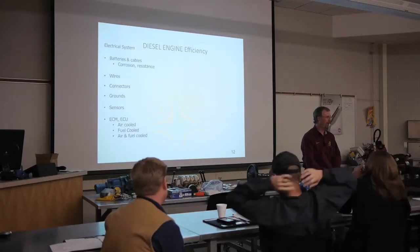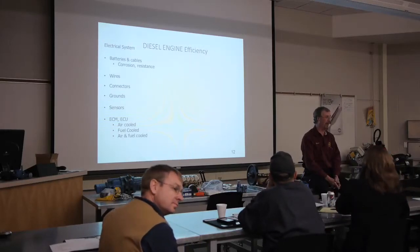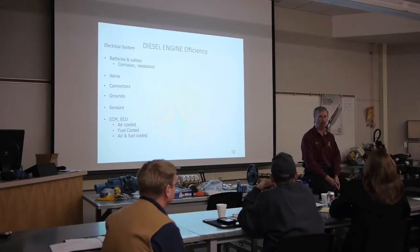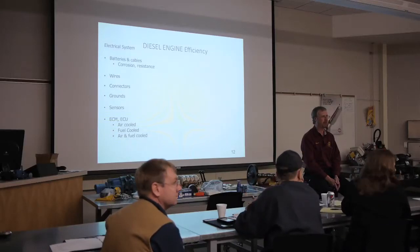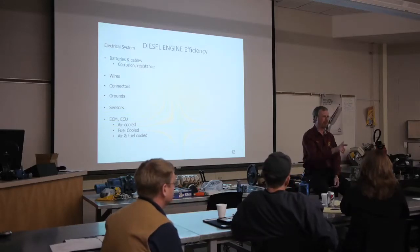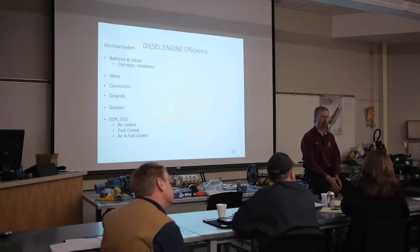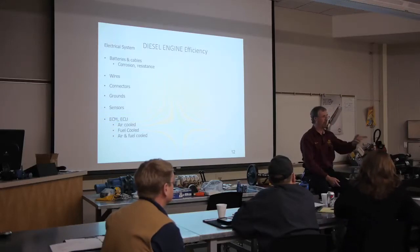There are two good points you made right there. Number one is, if we can get the batteries out of that vehicle or piece of equipment and we're going to lay it up over the wintertime, absolutely. It does extend the life of those very expensive batteries. There's no doubt about that. What if you disconnect the terminal? We'll get to that. That's another option. If we get the batteries out and put them in a nice warm shop, you will get a lot more years of life out of those batteries, absolutely. So let's go back to yours, and then we'll come to disconnecting.